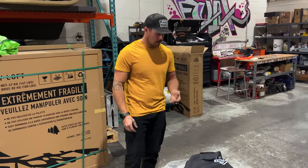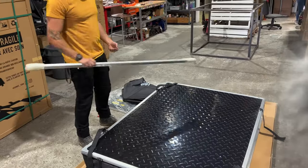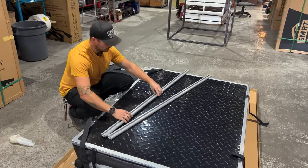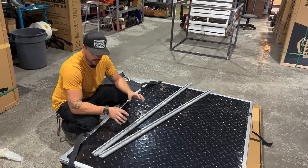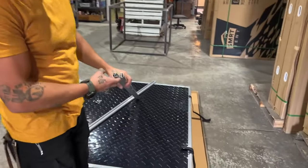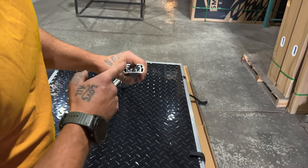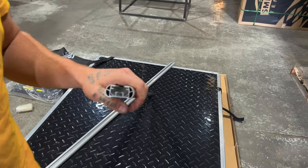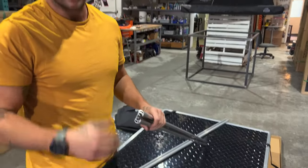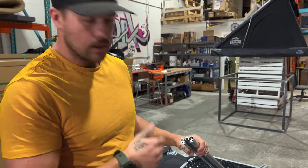We're back at our tent. We've got that little box of hardware — we're just going to take these straps off to the side. Now, while we've got these in our hand, this is one of my favorite parts of the tent. Structurally speaking, this is what's going to be attaching to your vehicle, and this is one place we really wanted to upgrade things. You're going to see that this is ovaled — we've got a single reinforcement on both sides, then another reinforcement, which creates a nice arc. These are at least two times as strong as your standard rooftop tent mounting channels. You can't bend these. So once we get this on the vehicle, when you're really beating it up going down the 4x4 trail, this is what you're going to want.